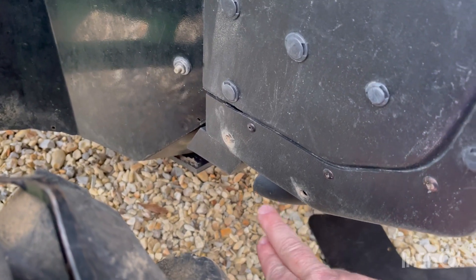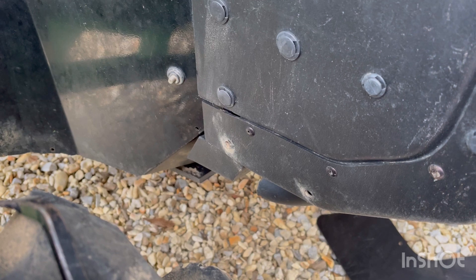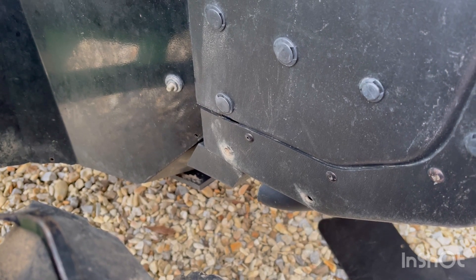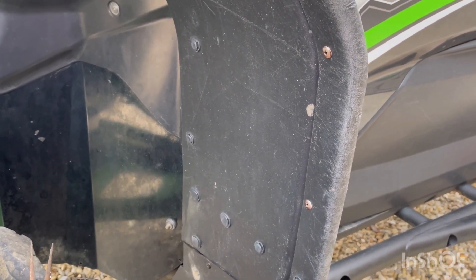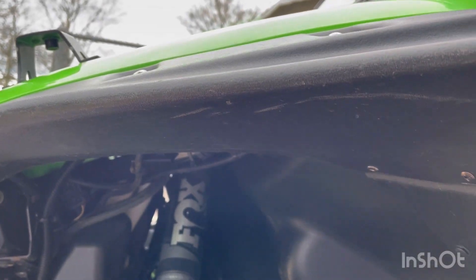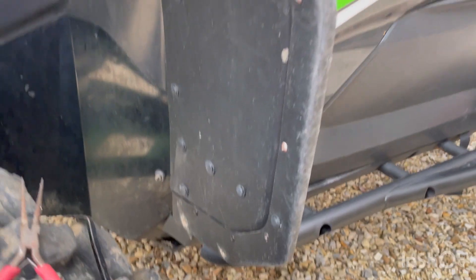I just confirmed I'm going to use the existing bottom two spots right here. I pulled out the existing rivet nut push pins to start installing with, so I'll use that to hold and align it up here with some clamps. There are a few places you have to drill to put in push pins — they include a whole bag of all that stuff. There are also a few places up here for nuts and bolts that you install, and down in this area there are two self-tapping screws.